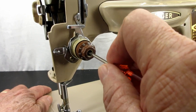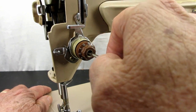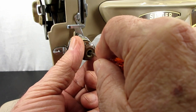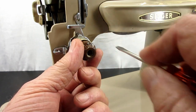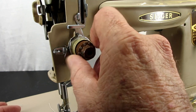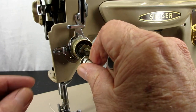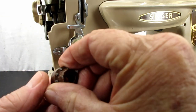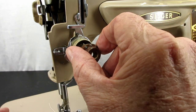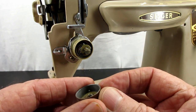You can see I'm getting a springy action there. You just want to push it back — it doesn't take much, maybe a sixteenth or an eighth of an inch. Push it back and now you can turn the knob, and once it turns just a little bit it's past the stop finger of the stop washer and you can just go ahead and unscrew it. Once you push that back, you can turn and both pieces will just unscrew and you have it off.